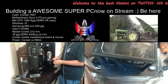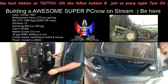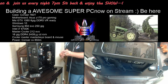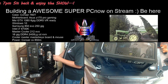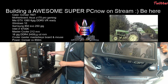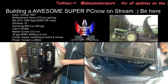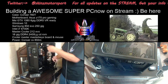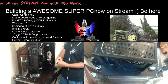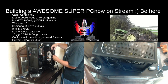This last power cord here is going to go up to our CD-ROM drive, and we're also going to make sure that we use the top one, because when we get our secondary drive, we're either going to use the SSD power cable or this cable to power that. Now if you really wanted to, you could snip each one of them wires and shorten your wire. We won't do that today.